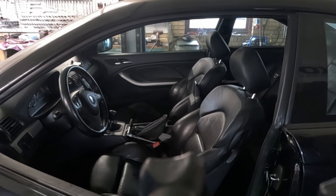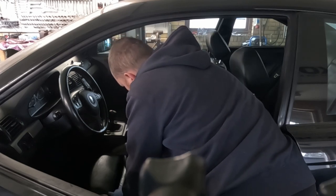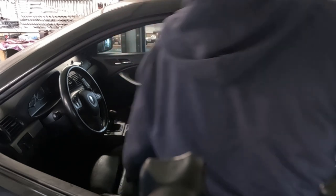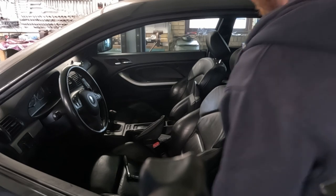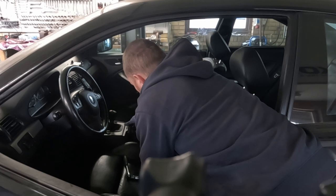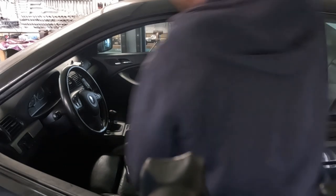Okay, now the wheel is actually braking. BMW says that at 1 click there shouldn't be any brake applied, so that's 1 click. I'll test. That seems to do it. 1 click, it isn't braking. We'll give it 1 more click. And now it brakes. Okay, we'll do the same for the other side.